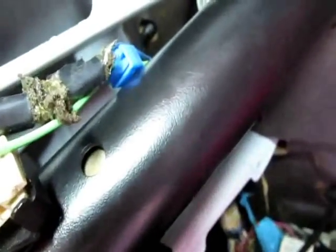Sorry for the shaky cam — it's a very very tight spot. If you want easy access, you drop the steering column. We're going to try to do it without dropping it. There are two different styles of clip: a round clip and this weird little square crab-looking grip clip. Getting a camera underneath there while controlling your body to get this clip off is tough. Use the longest pick tool you can and try to pry back that little tab — there's a lock tab that folds over, and then the clip should pop out.